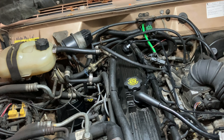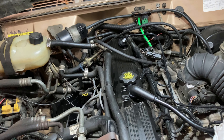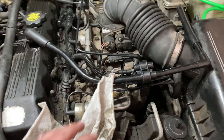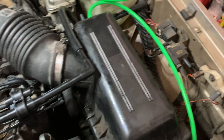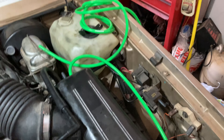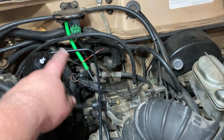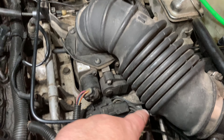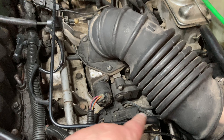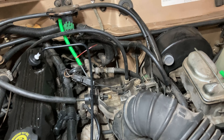Anyway, that's what we've got going. I have all these pretty new vacuum lines in. I've got some green holdover spare vacuum line from my Mazda, and this one had been broken so I put some on there as well, zip-tied in place so it goes to the correct spot — it was pulling off from the wrong spot. That's the correct spot for the crankcase ventilation.